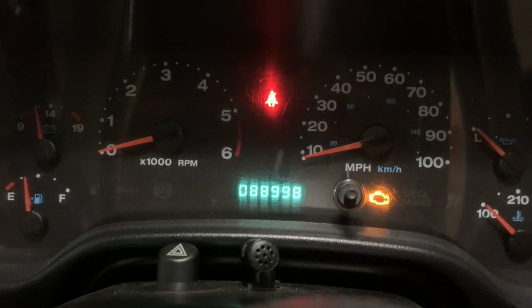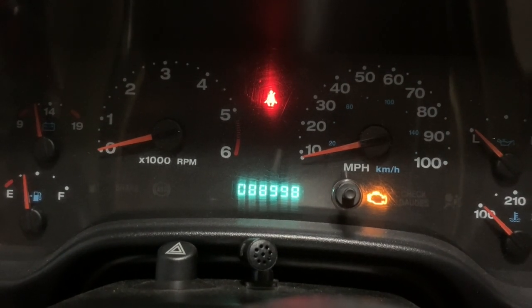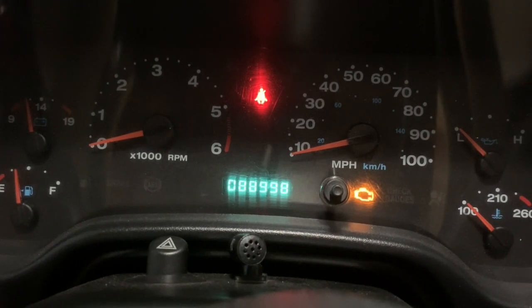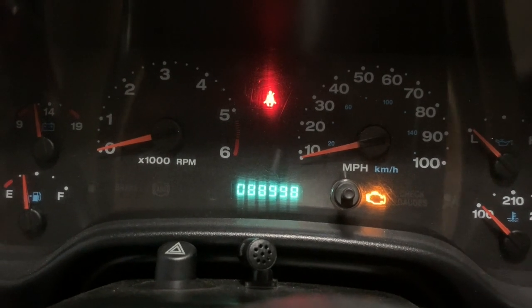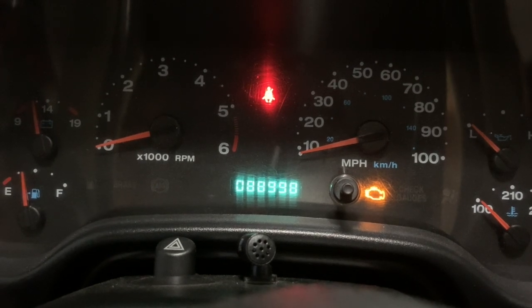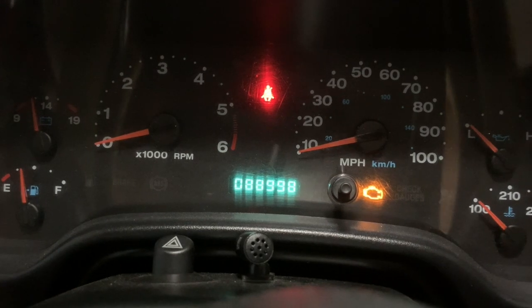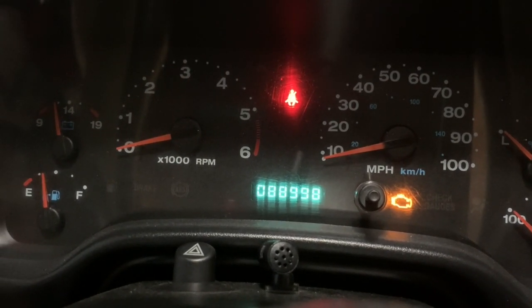Short of being the wire from the O2 sensor to the engine, I kind of got down to one last thing, and that was to get the software flashed — take it to the dealer, have them delete and reinstall the software on the car's computer. I did that, and within about 25 to 30 miles, the light came back on. So I'm feeling about 90% sure it's a catalytic converter issue.